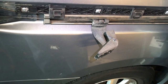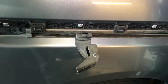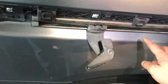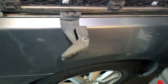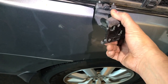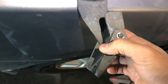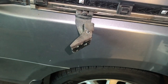I'm going to clean and grease up the rail. I have a special Honda grease for that. Don't put too much — just enough so the roller doesn't work too dry and doesn't collect too much dust. This trim protects it from ambient dust and water, so a little bit on the bottom and on top. I'll clean all this very good first — it's 100% dry with metal debris from the sliding. You can see this — it's completely destroyed.